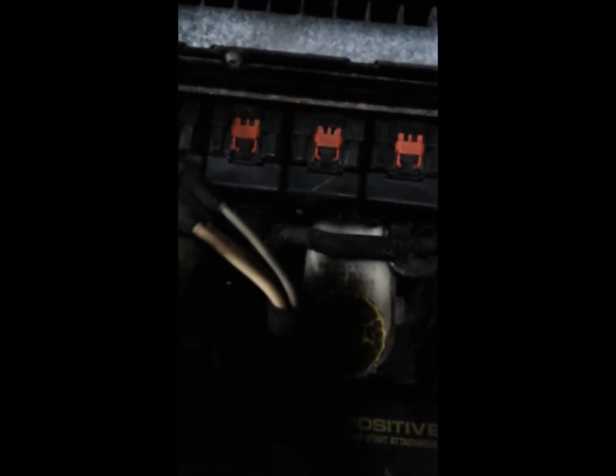So that all worked. It's all bled up good. I just went inside and pumped it up to push the pistons back out. And it's got a good high hard pedal, and the brakes apply and release. So that's good. I'll top up the fluid level here in the master cylinder. Yeah, it went down a bit. And then tomorrow we'll have a go at the back brakes.